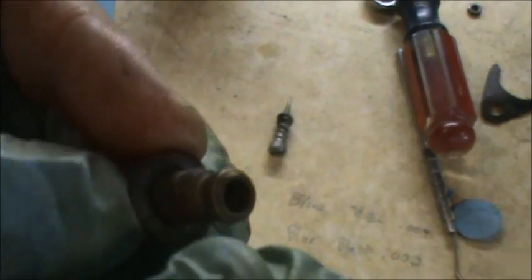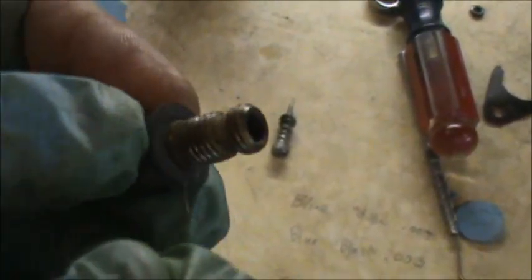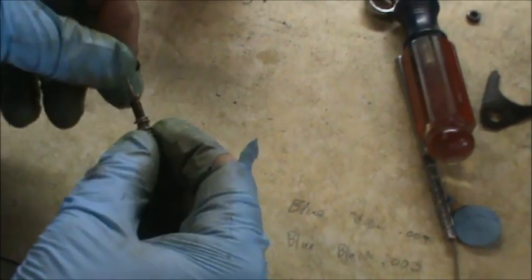I can see one of these holes — this little hole up top here on the main jet is clogged up. I didn't try and run the snowblower yet, but I could not see any light through there. So I'm just hitting that with a wire. On the bottom hole, I'm going to go through, wiggle the wire a little bit, and then go right through the center. I'm going to put a new O-ring on here and clean the tip of this needle. Now we're ready to reassemble.